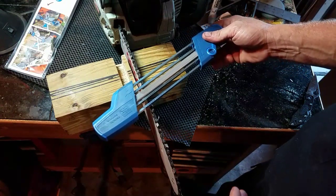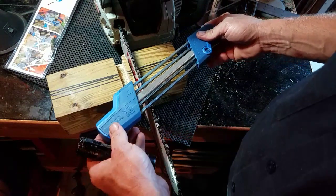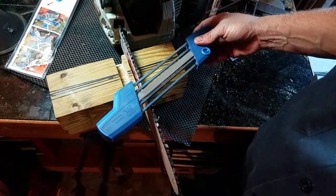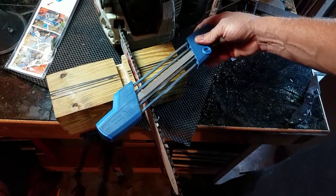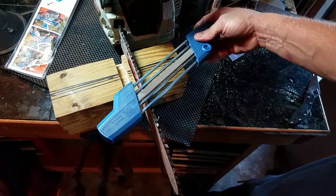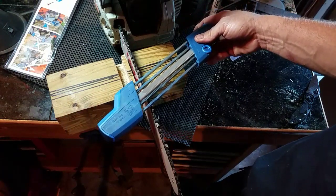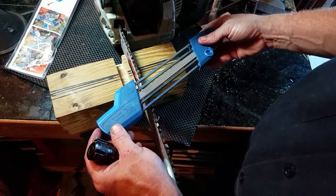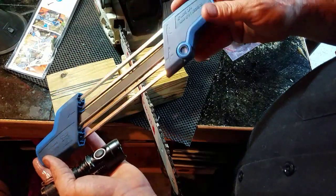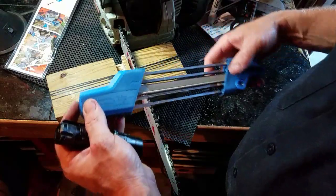When I'm done with the saw I touch up the chain right away — that way it's only a couple of passes. This is a brand new chain and I only took down about a 20-foot limb, roughly 10 inches diameter, limbed it and did a little bucking. I didn't get much use out of it but I found the factory edges are much improved when you use a file like this — the saw shavings you get are really good.